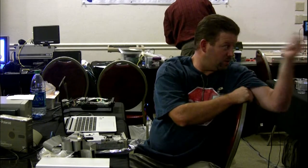The flippy-modded drives are not primarily about making the process faster — it's actually to get the back side read properly, period. The speed is determined by the other hardware. The Supercard Pro can copy a disc in 15 to 20 seconds. The CryoFlux takes three and a half minutes to read and another minute and a half to write, the difference being the number of revolutions per cycle — 10 revolutions per cycle for preservation mode versus fewer for Supercard Pro's quicker blind copy.